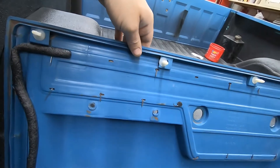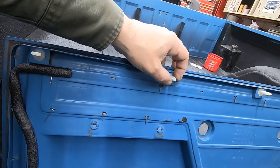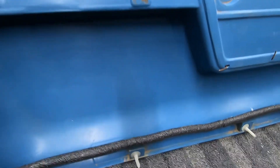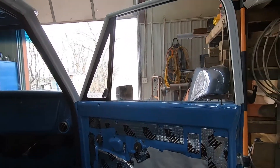So on the inside of this panel I couldn't find clips that I really liked. Some people call them push pins — I call them Christmas tree retainers because they have that little shape that looks like Christmas trees if you look really close. I've cut these things so that they don't grab as tight, because man, we'll never get them out of there without tearing them up. I also cut down some round foam — like you'd use to stick in cracks before you caulk stuff — just to help seal up the edges and stop any kind of plastic vibration or squeaking. Then I did put the shield piece on there and got those holes sealed up with kill mat, so we're going to stick this door panel on and see how it all fits.